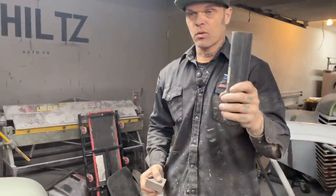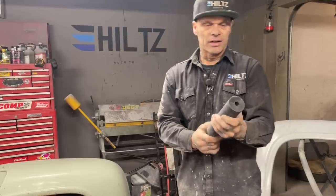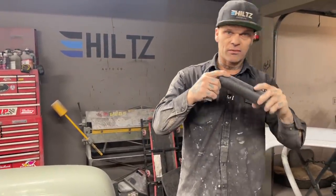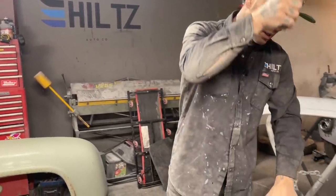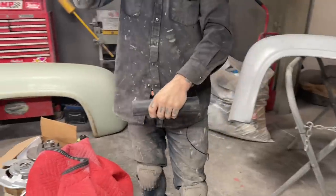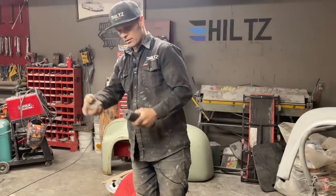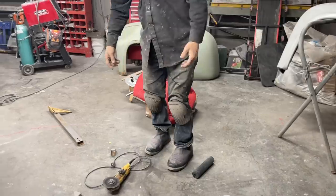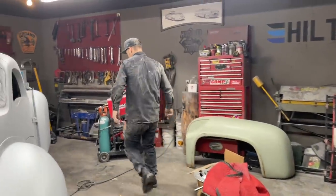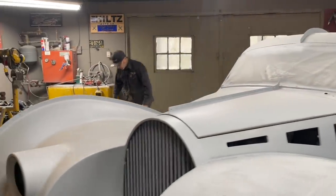This right here is what I'll use for rubbers on the body mounts. This is the rubber I'll use. I get this at Princess Auto. I guess it would be like a Harbor Freight, just boat roller. I'll cut that in a chop saw that chops wood, cut them to whatever width I want, and plunk each one on these mounts. But right now, what I'm doing is cutting the mounts because I want to go underneath there and stick them on. So that's my plan for today, or what I want to do at the present moment.